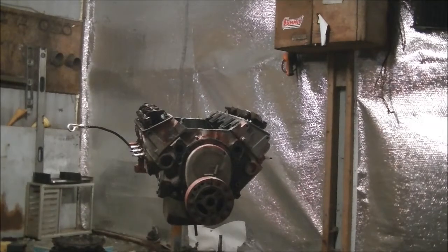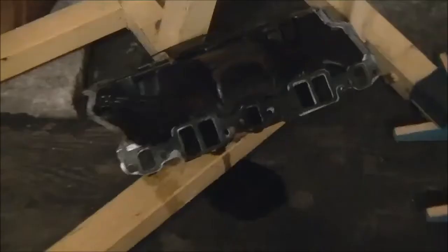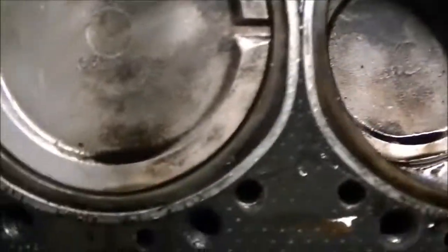I don't know about anybody else, but I put like 75, 80 foot-pounds on those bolts. I'm about to pull the heads off of it and see what it looks like. Not the right intake gaskets - it was sucking oil. Not only that, not the right head gaskets either.